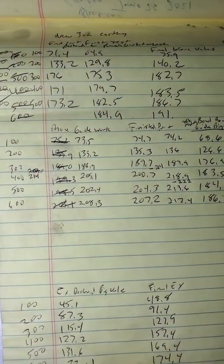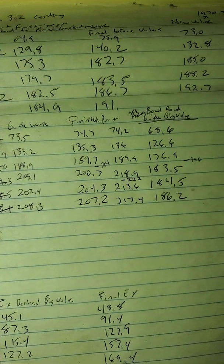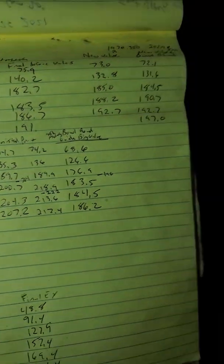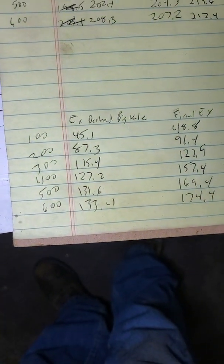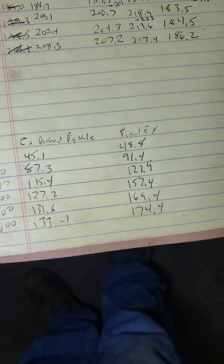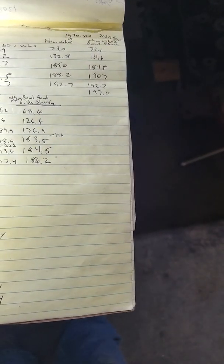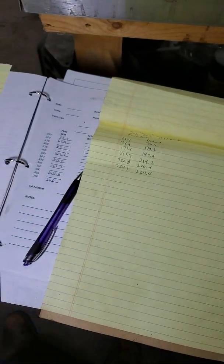This was on the worst of the two heads. Kept working on the guide and got it up to 222 CFM intake and 196 on the exhaust. The exhaust is also miserable stock — around 133 — got it up to 174. The other head, which had the better short side already, went 224 with the same basic work.